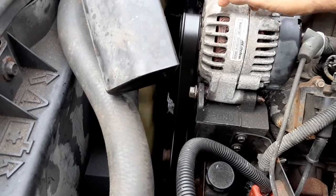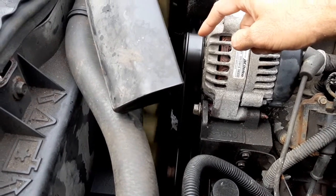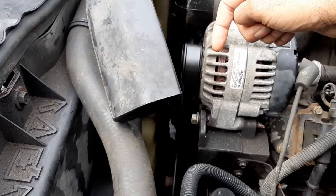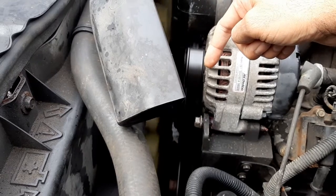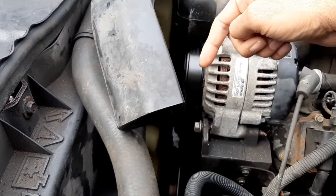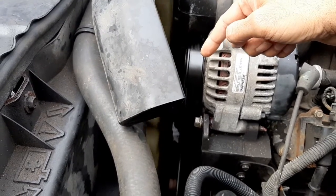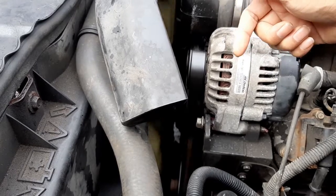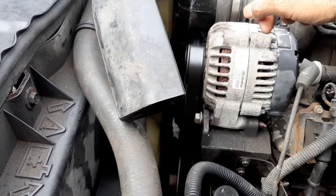There's no crack in the belt on either side — it's a newer belt. What I'll try is to replenish this belt two ways: first, brush it with a steel wire brush, very gently, like sanding the surface on both sides — the inside grooves are most important. Second, I may apply some silicone lube or rubber lubrication to make the rubber softer, giving better traction so it doesn't slip. This noise should go away. Maybe every three or four months you'd need to re-spray, but it shouldn't dry out like WD-40.